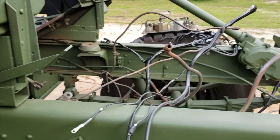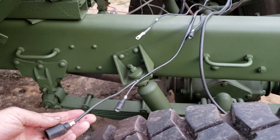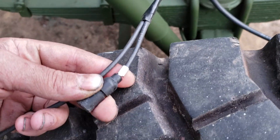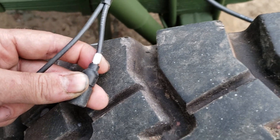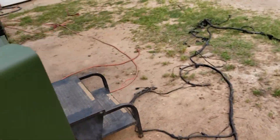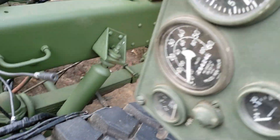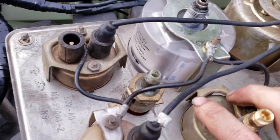This leg we identified positively the other day as 55 being the flame heater, and this one — number 33 — that's going to be your engine coolant temperature sensor. So wire 33 from over there we can plug in to the spot on the back of the coolant gauge. Temperature sensor goes right there — plug 33 right there.